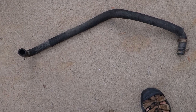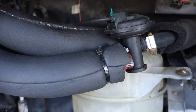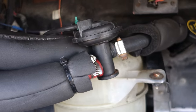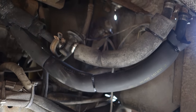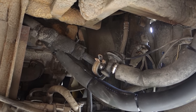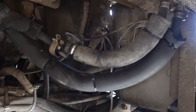It's about 3:30 in the afternoon, so UPS should be here any minute now. Here's what I've done under the hood — I've insulated those lines. See, all these were just regular old stretches of heater hose uninsulated, and I can almost guarantee I was losing some heat through there. Down here in the wheel well, I insulated the lower one and the upper stretches of that other one. There was some insulation on these down here but it was really rough and falling apart. Hopefully when we make it up to Canada and Alaska this springtime, we'll be pumping out some serious heat out of our heater!